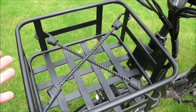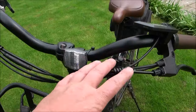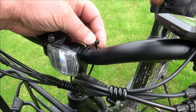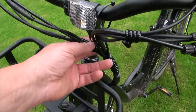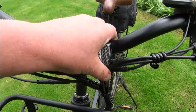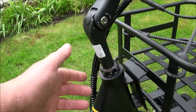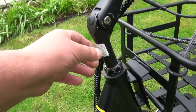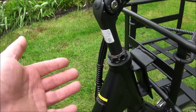The basket has been really handy on the front — it doesn't come with the bike, but it can be bought from the website. It's big and solid. All the cables and everything are still perfectly in position, although when I fitted the basket I did put a little cable tie on here just to hold them back so that when I turn the wheel it doesn't rub the cables. They are insulated cables, but I thought I'd just hold them out of the way. There are marks on the headset — I've had to tighten that up, possibly around 50 miles in. The headset came loose and was rocking backwards and forwards, but since I tightened it, it hasn't come loose again.